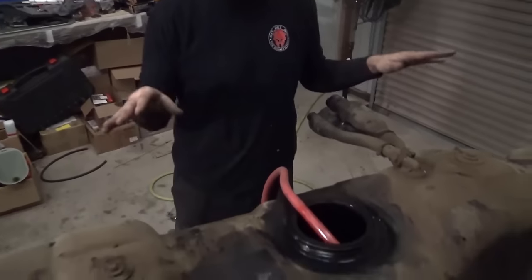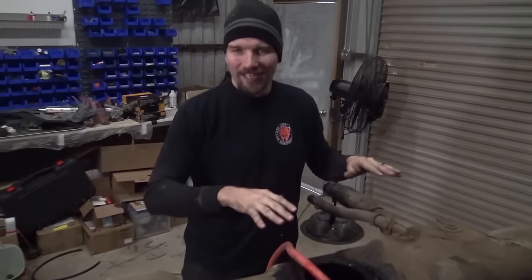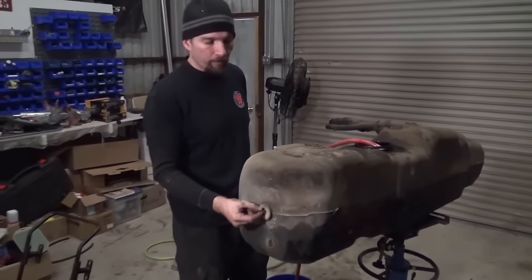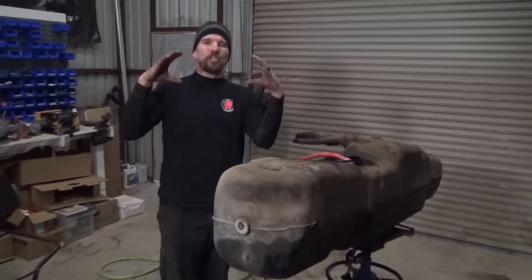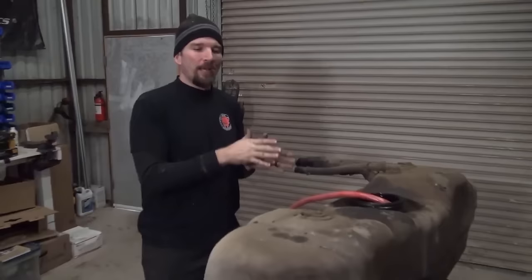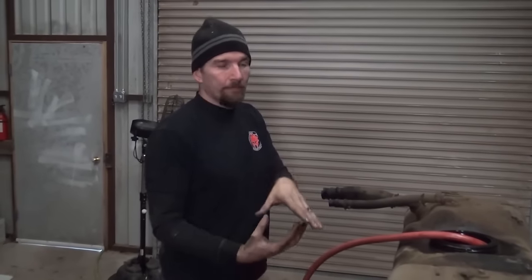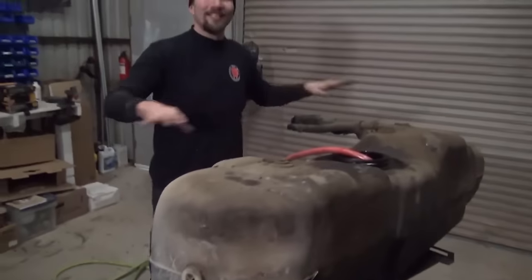The reason you do not have drains on fuel tanks anymore is because of the design of this fuel tank. You see this line on the side right here. This isn't actually a parting line. Where this plug is, this entire tank assembly comes in a big, very thick plastic tube. They seal one end down here with heat. Over here, they blow in air and it blows it out into a mold, they call it blow mold injected. When they're done, they take that plug out and seal it, so it's all one solid piece.